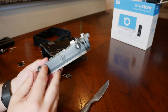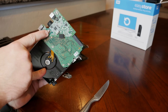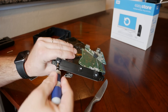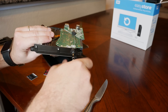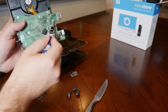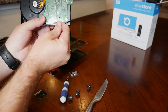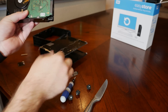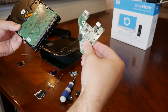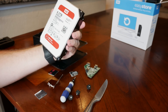A few more pieces to remove. You'll need your Torx screw bit to remove these four posts with rubber on them. We'll also need to remove this one Phillips head screw to remove the board that provides the USB interface. This piece of plastic is just inserted into the other screw hole — if you pull up, it comes out. Remove this board; it's connected to the SATA connectors here, so just pull it out and away. And that is a bare drive, ready to go in your NAS.